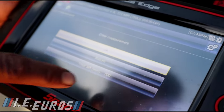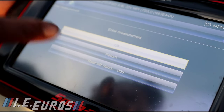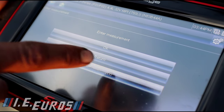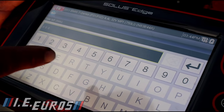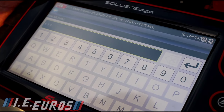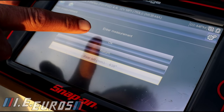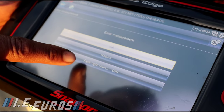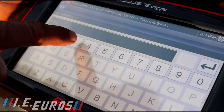The rear left is the driver's side. To raise the suspension, you have to enter a slightly lower measurement — we are going to apply 638 millimeters, which will cause it to go lower in value but raise the car. Let's do that and continue. Now we'll do the right rear and apply the same value of 638.